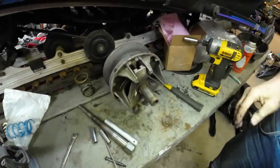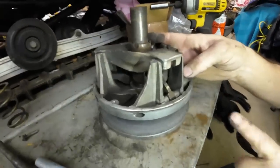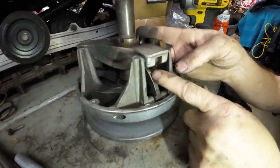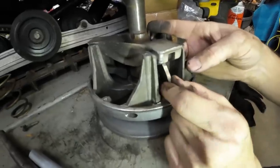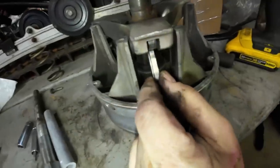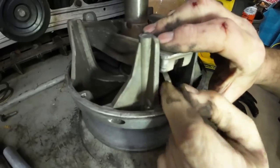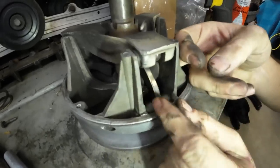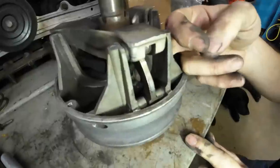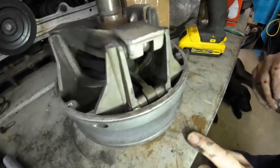She's pretty much junk. All right, Dennis continued a little investigation. What else we got? So this weight's worn just all on one side. It looks like what probably happened is it was caught up in the roller. Yeah, that thing is junk. And then it would just wedge on the way back. Wedge be stuck. Yeah, that's a good 16th of an inch ledge there. Yeah, and it's got a taper to it, so that's probably how it was locking. That's all those shavings we just dumped out.